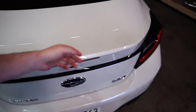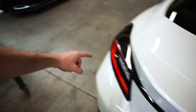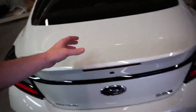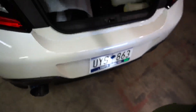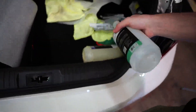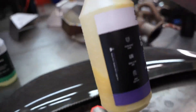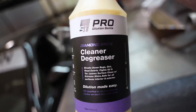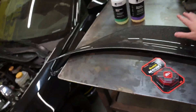Number two, if you look at my car, it's not exactly clean — trust me, there's a little bit of dust on it. Before you do any sort of cutting, mounting, or anything with adhesive, you have to clean the surface or it won't stick, and you risk losing that part on the highway — which is another reason I want to drill it. I have my detailing spray wax here from Superior Image, and I'm going to clean and wax the wing so it looks nice and shiny when it goes on the car.